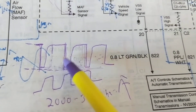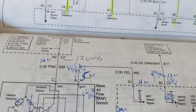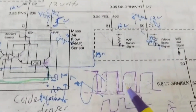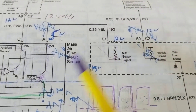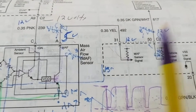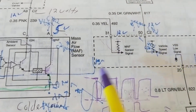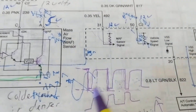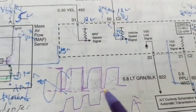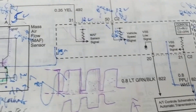They should be linear - I'll show you on the scope I was using. I hope this cleared up a few things, so that when I go out there you'll know: don't use a multimeter, we have to use a scope to look at the signal. You cannot use a multimeter for this - I've been saying this for 30 years. All it's going to tell me is the DC voltage, and that doesn't tell me how the signal looks. How the signal looks is the most important thing for me. Go to the next video for the oscilloscope.